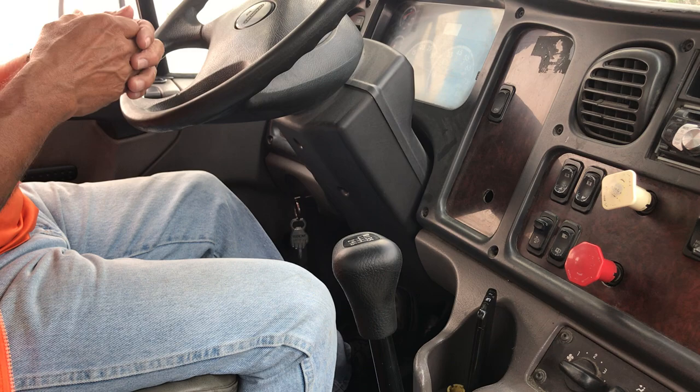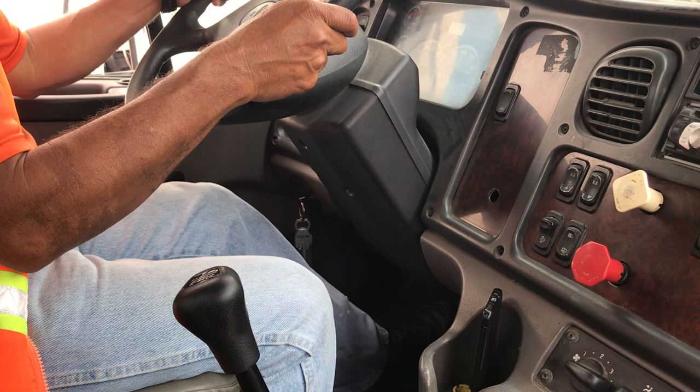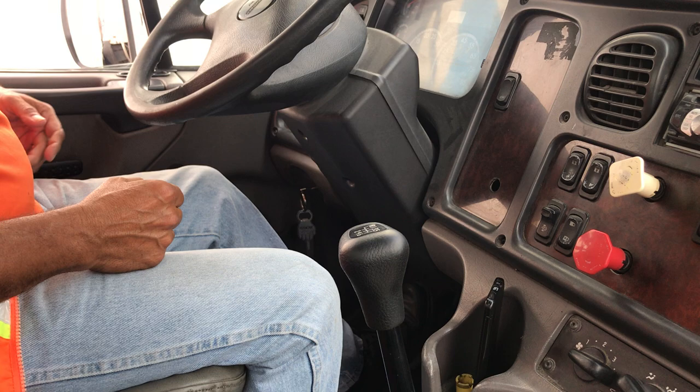Now I'm doing a switch — I'm doing my trailer parking brake test. I'm going to release my tractor brake and do the same thing. My trailer parking brake test is a good test because when I try to move my trailer, the trailer holds on the road.